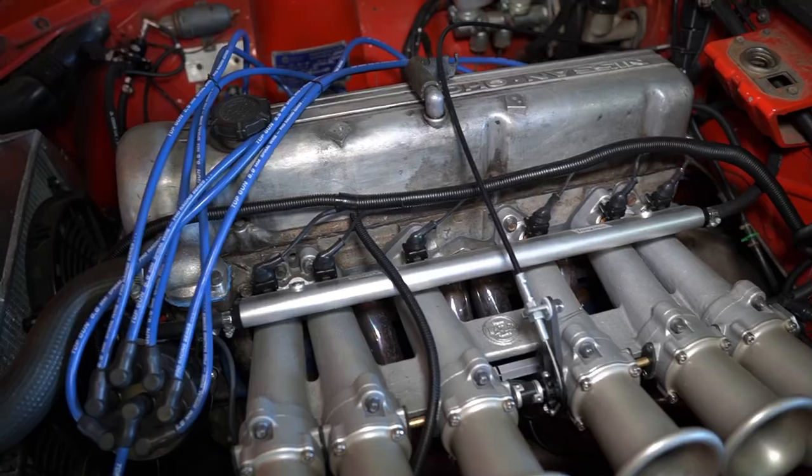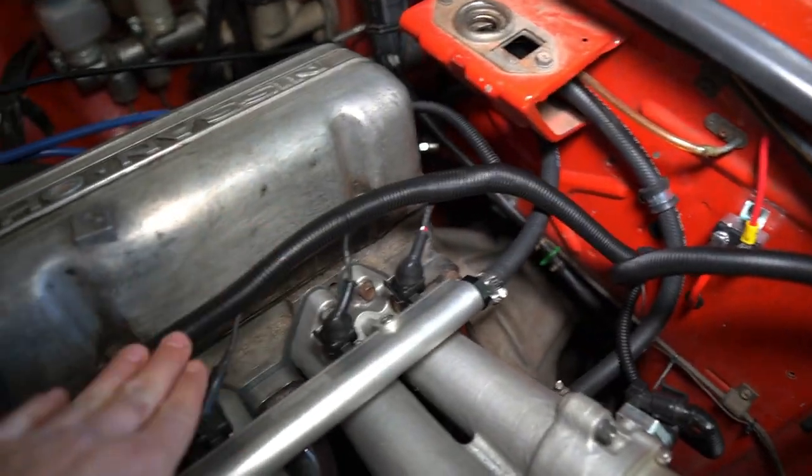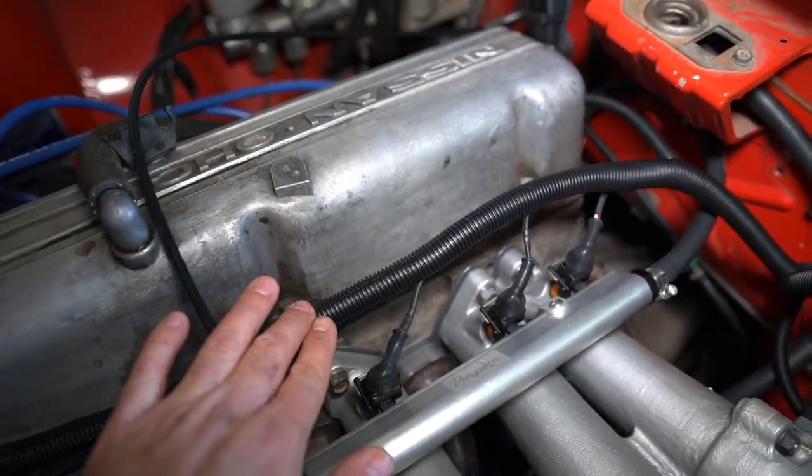I've bought all sorts of bits and pieces off them. I also bought a proper F-crimp tool, which I recommend if you're doing a lot of crimping — just buy a good tool. EFI Hardware ship internationally and I'll put links in the description. So this is the wiring here. It all comes in through the original factory hole for the old choke for the SUs. Inside there are two different looms: one for all the injectors, which goes to the expansion card, and the other loom is essentially all the sensors. There's also the twin-core microphone-shielded cable I got for my trigger.